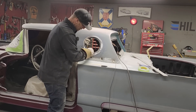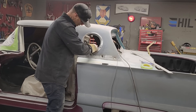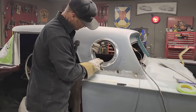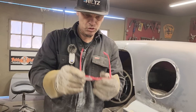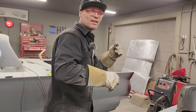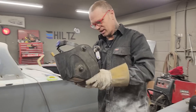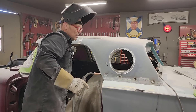I'm going to leave that filler there while I weld this up, and I'll tell you why — when I put the heat to that, the filler on that metal is an excellent insulator. It takes the heat so it kind of keeps your metal in place. I probably have metal that's oil-canning there or stretched a little bit — shoved in a little too far. We'll weld this up and deal with that, but leave the filler on there for protection from the heat. Man, that thing's fitting good! Now let's get the old welder going.